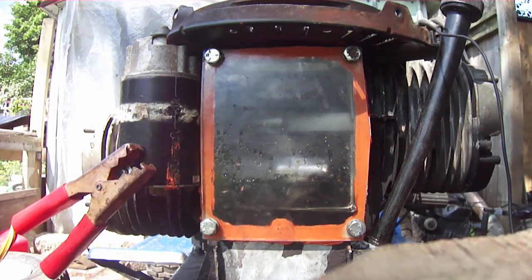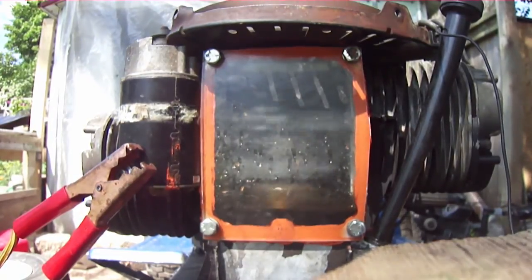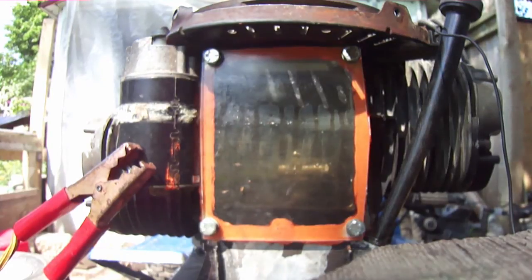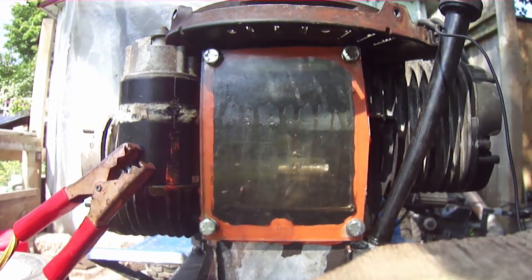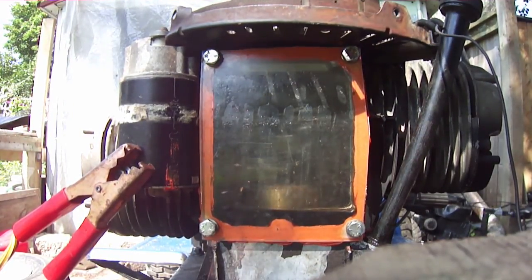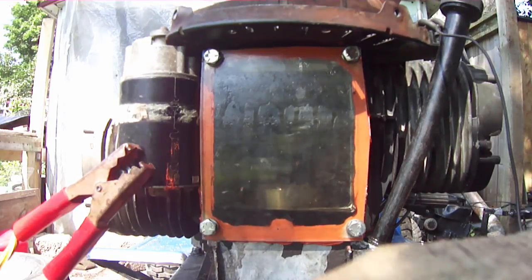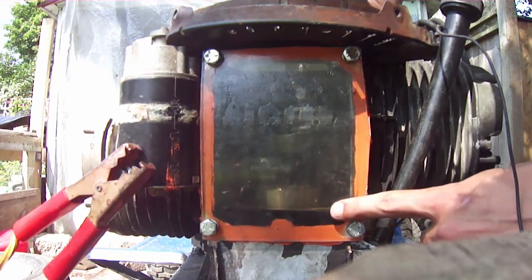I can try giving the starter more voltage, I can spin it faster. Well, that was working better - that was like 24 volts. I spun it up on 12 first in bursts just to help take some of the initial kick off of it. That seemed to work. Now I can see that the top piston rod is wet, and everything else - that window actually works pretty damn good even with the dirty oil I put on it.